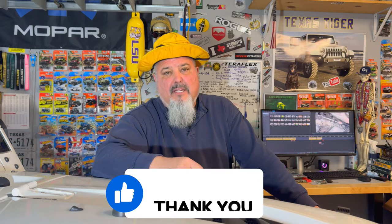That's a wrap. Just want to point out a couple of things: Adams has a great technical helpline, so if you have any problems with their products, call them — they're happy to help and stand behind their products. Also, for that 160 foot-pounds on the 1-1/4-inch nut on the transfer case yoke side, make sure you use an appropriate torque wrench to get the full swing and ensure you torque it to spec. If you have any comments, please leave them on our channel, and thank you for watching.